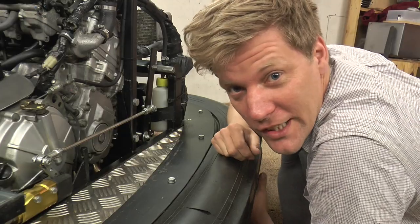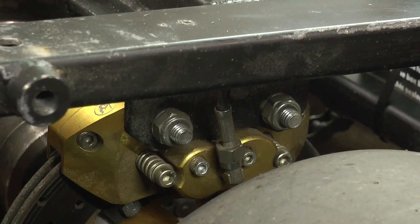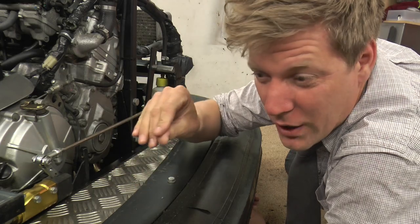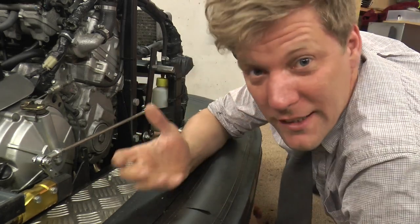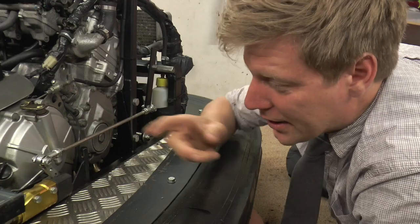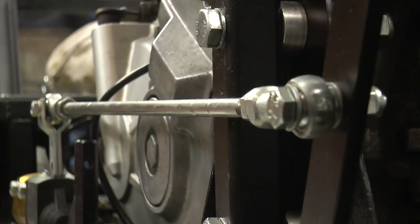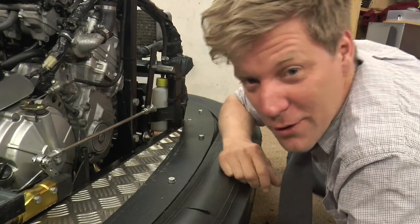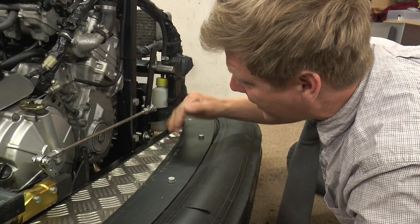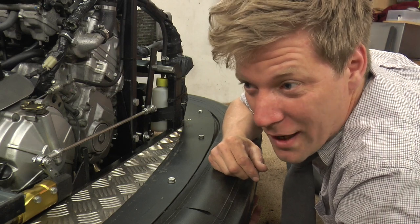One thing that did change was the brakes. Originally I wanted to use the front brake lever master cylinder off the motorbike, but because I'm using a go-kart rear caliper they require a lot more fluid to activate them - so you'd pull it in and had to pump the hell out of it to get it to squeeze all the way back. I mean it did work, but I could hardly say to old sticky boy 'your brakes will work at 100 miles an hour but only on the eighth pull.' The solution was just a simple foot brake on the master cylinder that came with the go-kart. You look at this now and think why didn't I just do that to start with - it was because we didn't think we had enough room. Yeah, brakes work pretty well, which is a bit strange really because on most of my machines the brakes are absolutely terrible.